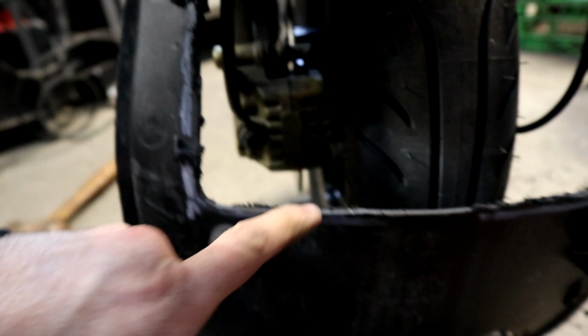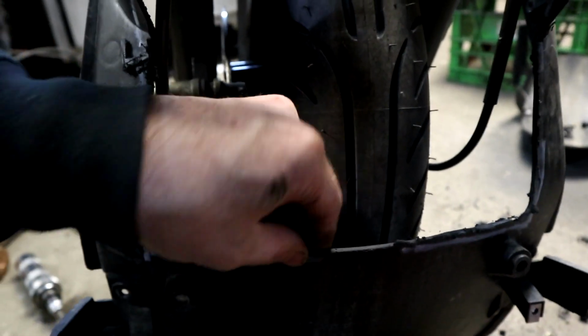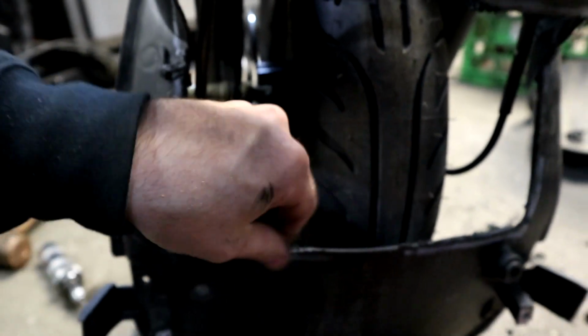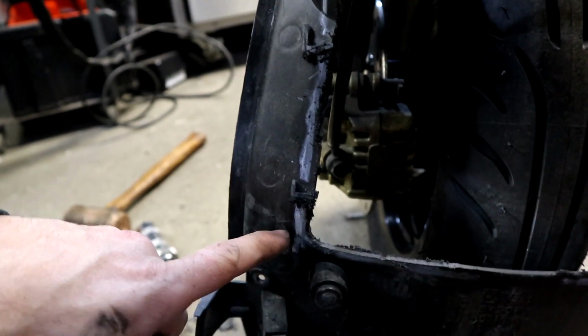So even just there without deburring it, that's dressed, that's rough. So you can get it quite nice if you do. Just take your time, use the flapper wheel, knock all the sharp edges off. You can get it almost looking like it's supposed to be there. And then the radius corners just look nice. You don't have big cuts in it.